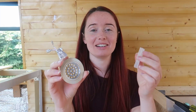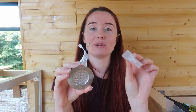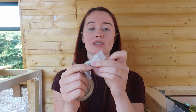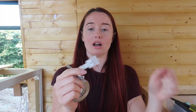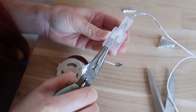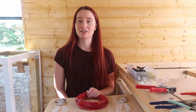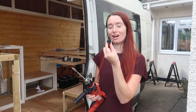Now we've added crimp connectors to all four lights, we're going to use these three-way blade terminals to wire them all together. This goes in one side and allows us to join the lights — a wire coming out one side goes to one light and the wire coming out the other side goes to the next one. We're connecting the female end to the male end inside the terminal. Now that we've added all the three-way blade terminals onto the lights we just need to connect them all together using 1.5 millimeter wire.